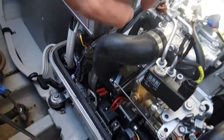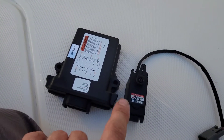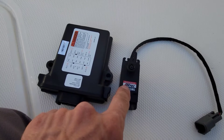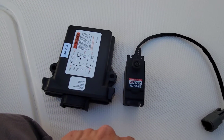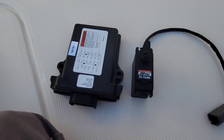So we're going to change out this throttle arm and this boost board. We've got a new one right here. The reason is they've reprogrammed this so that it won't get burned out. I guess this was sending too much voltage to the actuator, and what happens is the actuator stops working because it pretty much gets fried inside. So they've changed their settings for both of these and now it works fine.